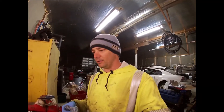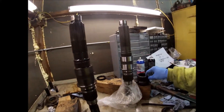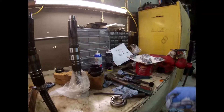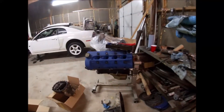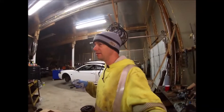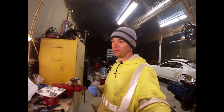The main reason I want to go through this and share this with you is so you know what to look for if you tear into your transfer case. I've seen videos where they tear through the transfer case and don't really explain what went wrong. You definitely need to look out for this. When you wipe out this shaft and this hub, the shaft is like a hundred-something bucks and the hub is 80 or 90, and with the rebuild kit for the bearings and seals, the tail housing, and the new pump...